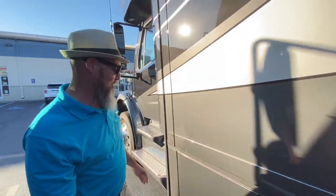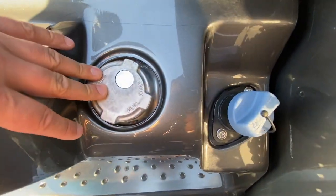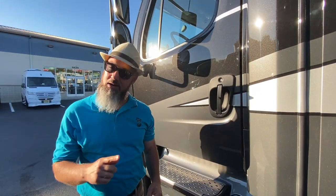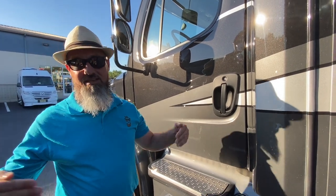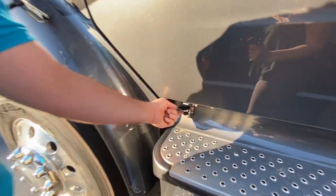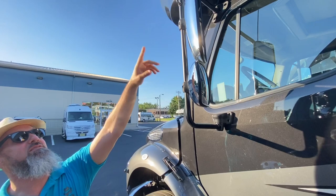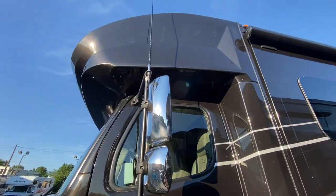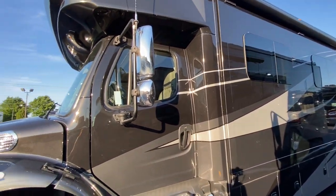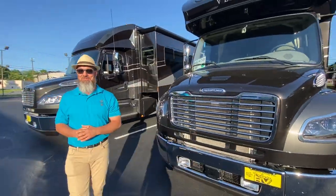In the back you have a connection for your air compressor, which delivers 18.7 cubic feet per minute at 120 PSI — you can fill bikes, rafts, even an RV tire. Up here is your DEF — diesel exhaust fluid — and you have twin 50-gallon fuel tanks connected by an equi-flow tube that transfers fuel between tanks with the ignition on. The engine block heater is right there. You have power heated top mirrors, with the bottom mirrors being your blind spot mirrors. This is prepped for a CB antenna. The coach has a fiberglass roof, and both slide-outs have slide toppers, with a turn signal camera up front.